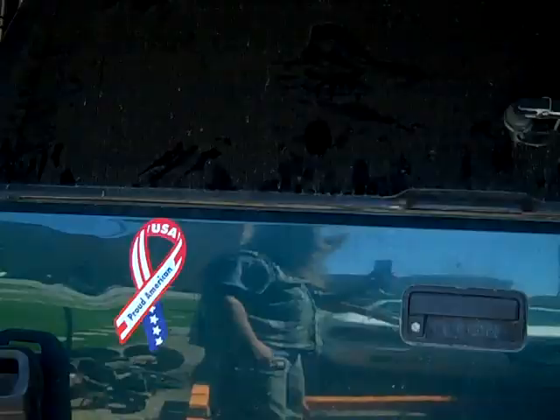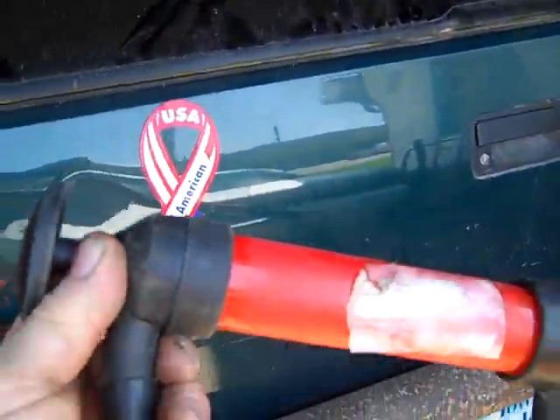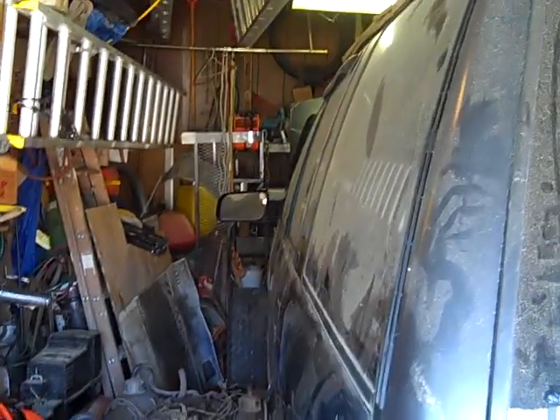Of course I'm also going to change out the fluid in the rear differential and the front differential. Got a nice little siphon pump here — I can do the fluid change with that, so that won't be a problem. We'll just set that right on the Harley for now. As I said before, limited space to work in in this garage, but I've been managing to get it done. So that's what I've been doing for about the last week, and it's about time to get back into it. Stay tuned.